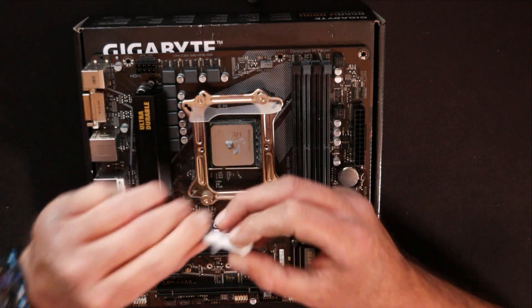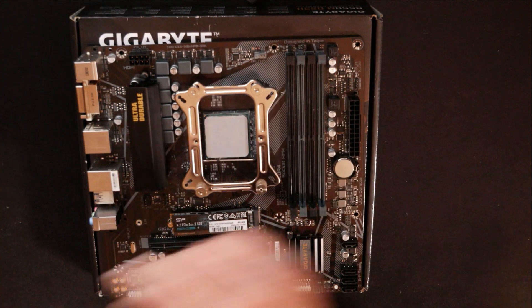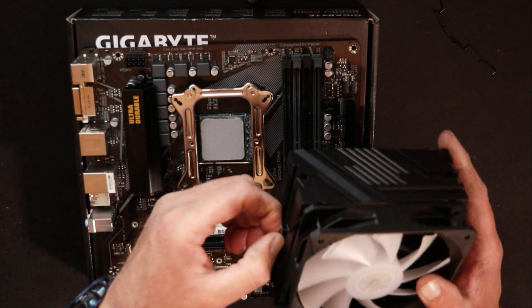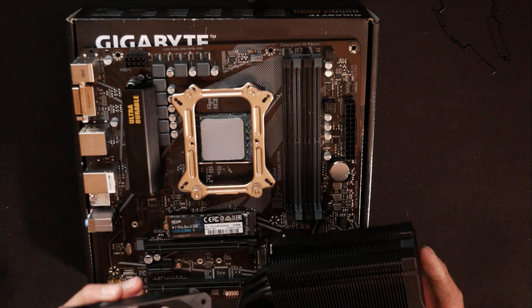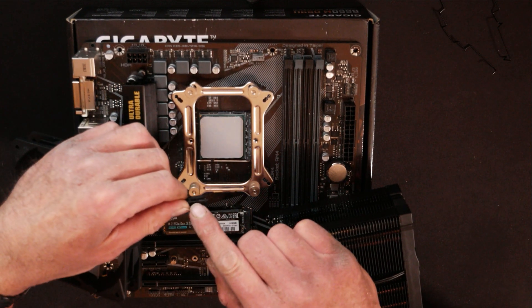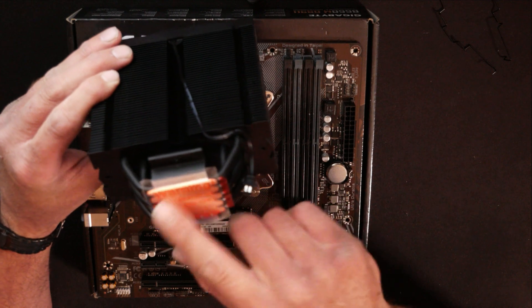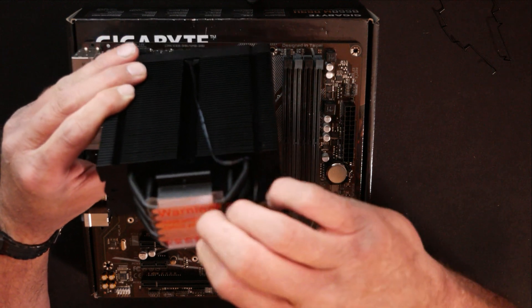Another reason why I spread mine out is if I don't put enough on, I can always add a little bit more. I think it's a pretty good application — there are a few thin spots but it will spread out as it heats up. Now we're going to take the fan off the heat sink by pulling on those two little clips. You have to make sure you disconnect this LED wire here from the fan and the heat sink — push down on that little clip and slide it apart. Set the fan to the side. There is a warning that says 'please peel off before use' — you do need to remove this plastic coating. If you don't, your CPU will overheat and that's not a good thing.